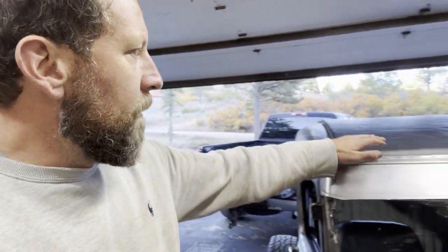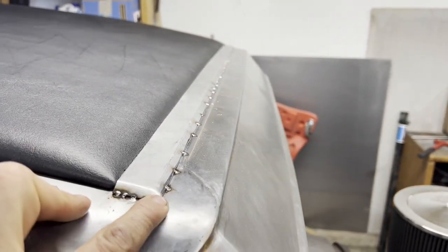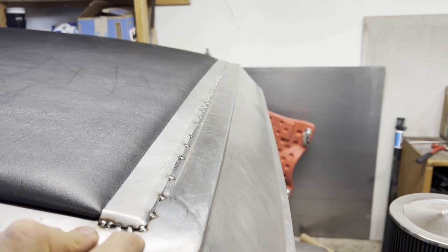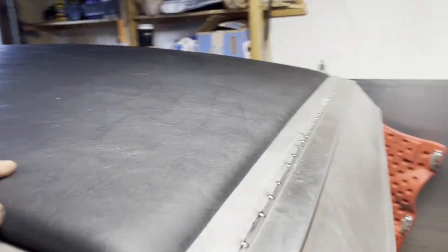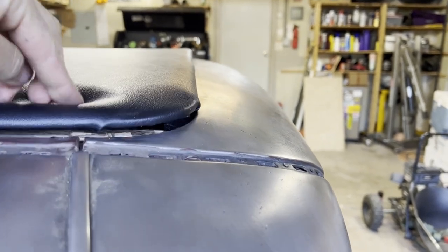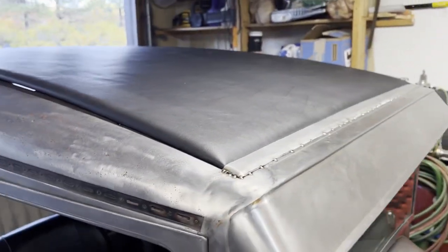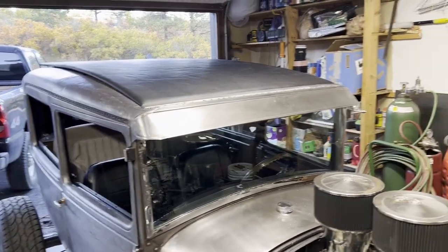It's been a day. I worked most of it and got a lot done. All I need to do now is go through and put my bolts through — I'll use my hot poker to punch them up through the vinyl. Check it out — my front rail got it tacked in. A TIG welder would be nice to go across there cleanly, but I'll do it with the MIG and grind it. It's got a good three-quarters of an inch slipped under there. I'm not an upholsterer — I'll just leave it at that — but once I get it squared up I can poke my bolts through. You'll see the bolts, but I couldn't think of a real easy way to hide them anyway.